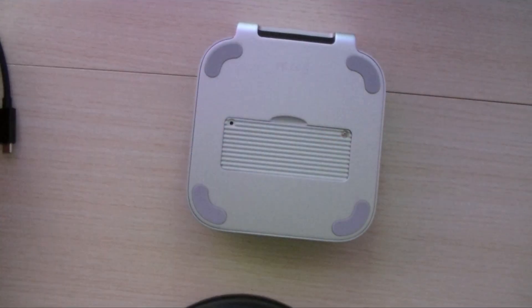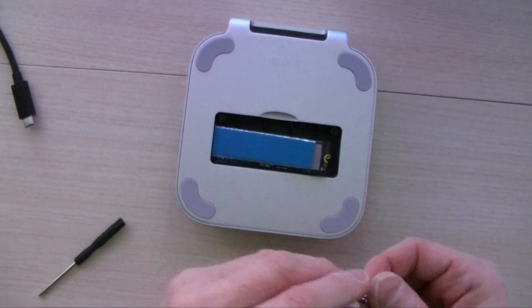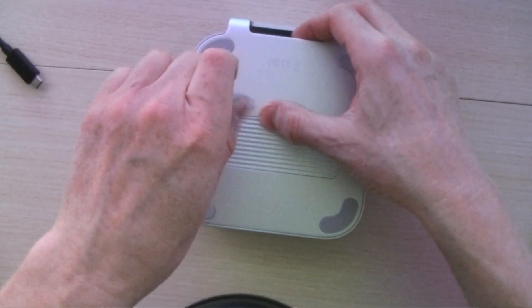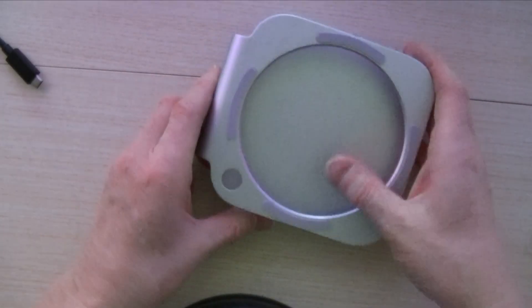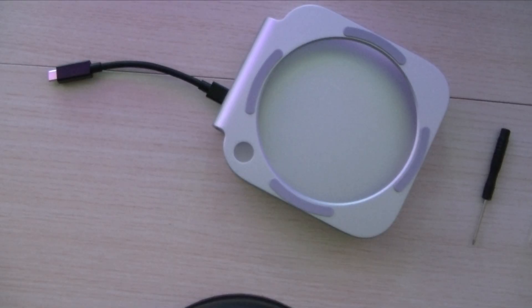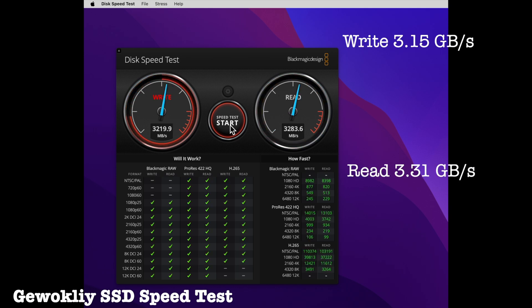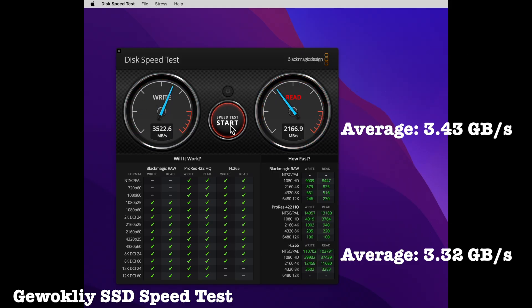Now let's install the SSD. I'm using a 1TB Samsung drive I got a few years ago — not the fastest, but the only spare SSD I have on hand. To test read and write speeds, I'll use Blackmagic Speed Test. The data transfer rate between the M4 Mac Mini and the dock should be at USB 4 speeds — a theoretical maximum of 40 gigabits per second, or about 4.8 gigabytes per second. After running the test several times, the results show I'm getting a bit more than two-thirds of maximum theoretical speed. Some people will say that's pitiful, others say it's great — I'll reserve comment.